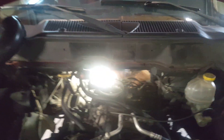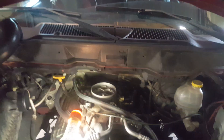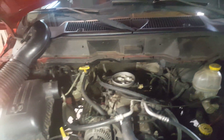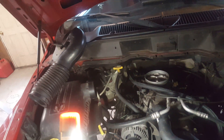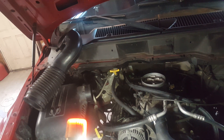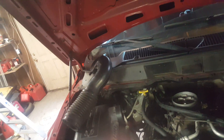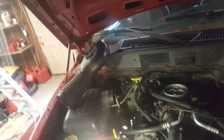One thing I will go ahead and let you know — I was reading the instructions on the new one I just bought. It says you must drive the vehicle over 40 miles an hour so that it resets itself on the idle. I haven't done that yet, but I just wanted y'all to know I've got it done. I'm going to go ahead and tighten the intake box up and everything, and I'll take it for a spin. I've got to make sure I go over 40 miles an hour — that shouldn't be no problem.